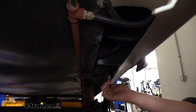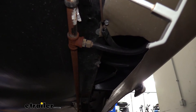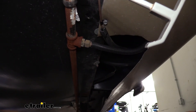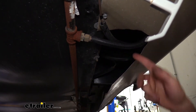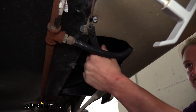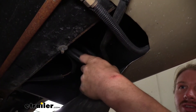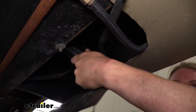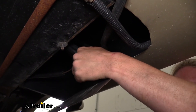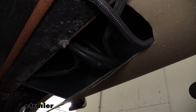Just in front of our axle, I pulled this panel down so we could hide the excess line. Because this line is very long and we don't need it to go beyond the axle, we want to stop right about the axle — so we just take it and coil it up right here. To prevent any noise and keep anything from rattling, I wrapped vacuum line around these coils as well and secured it with a clamp and some zip ties. The zip ties are only around the hose so there's no direct contact on our brake line other than the hoses wrapped around it.